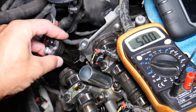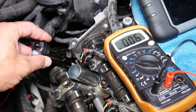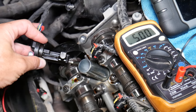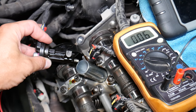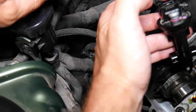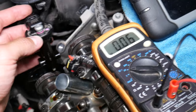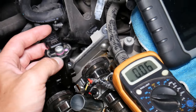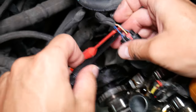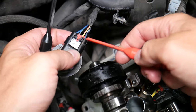Five volts. If you come close to the wheel there's a specific point where the magnet activates — zero volts. You pull away — five volts. You go down — zero volts. You pull up — five volts. It only activates at a certain spot on the wheel. If I go left — five volts. Right — zero. Left — five. So the left sensor is working. Now if I test the right one — nothing happens. So I'll move the probes from wires three and four to wires one and two, the other signal wire and 12-volt supply wire.